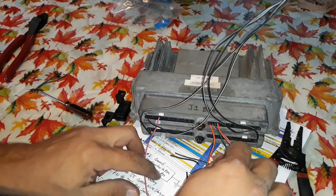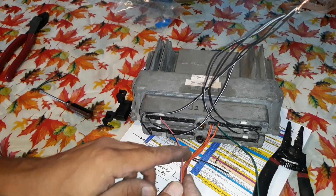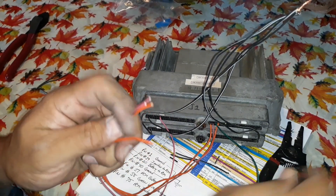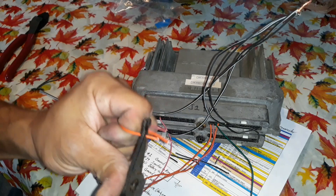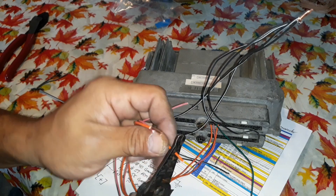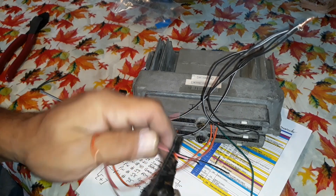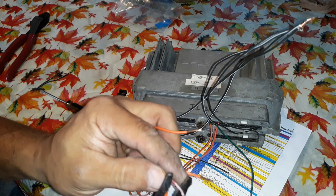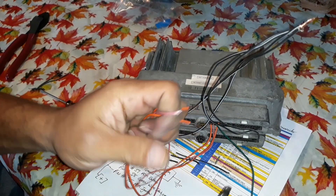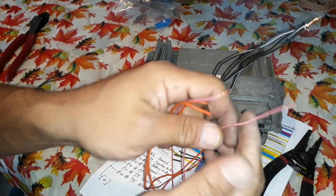Moving on to the other ones — leave everything but the green, because I already know that green is going to be my OBD2 port. So all the pinks and oranges are battery supply. I'm just going to get the vinyl off here, expose the wire so I can solder it too. All I'm doing is basically so that you guys are able to do this yourself and not go in to somebody else who's going to charge a lot of money. I'm doing the research for you so you don't have to.